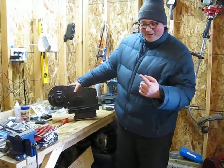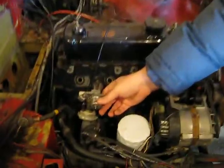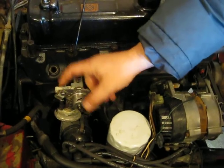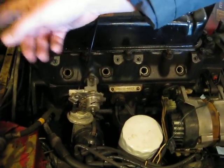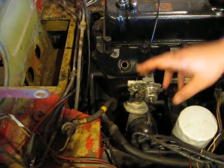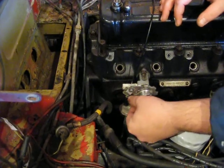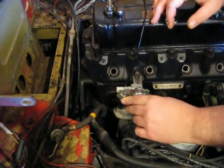There's one other thing that might be the valve — this guy right down here. You've got a hose that goes from here to the heater unit, and this valve just opens and closes. If it's stuck or not moving, that could be your problem as well. Maybe it's just an adjustment you need to make on that valve. John Twist over at University Motors has a pretty good video on that, so maybe I'll put a link to it in my response.